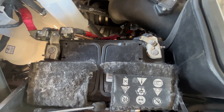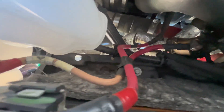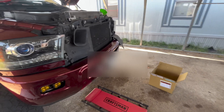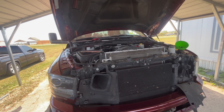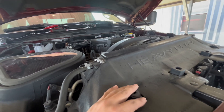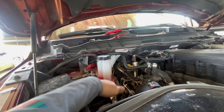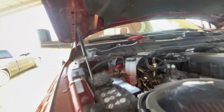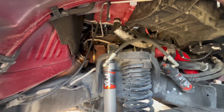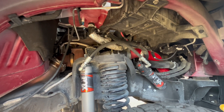We got the battery reinstalled and all our cables back on. I ended up having to add zip ties to all these cables because all those tabs broke. Then I went ahead and reconnected the battery. Next we reinstalled the front grill, the top cover, and refilled our coolant reservoir all the way to the top. Once you get it started, get it up to operating temperature and check your coolant level — if it's still not at level, repeat the process. Also check for leaks at this time.